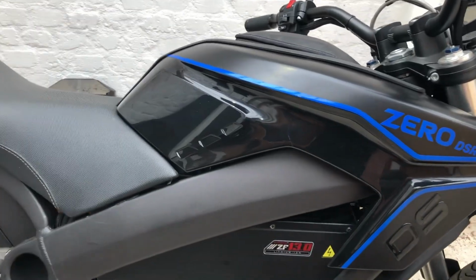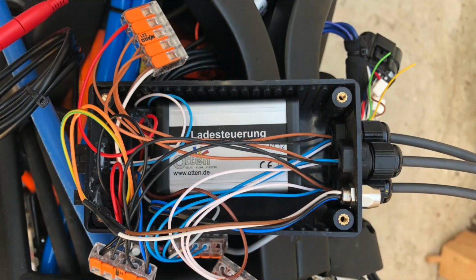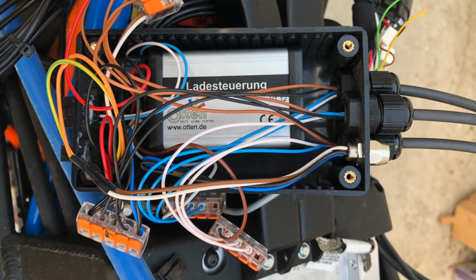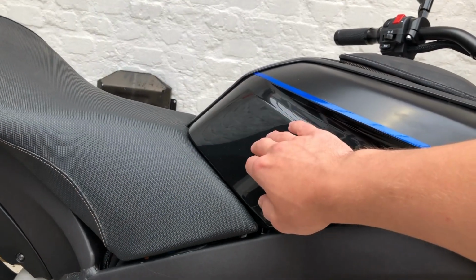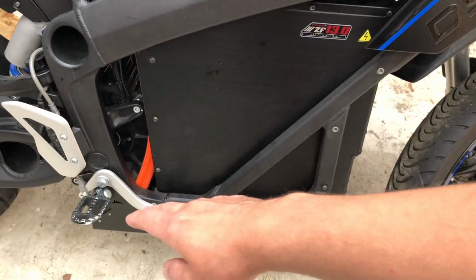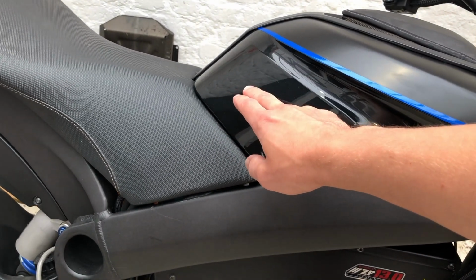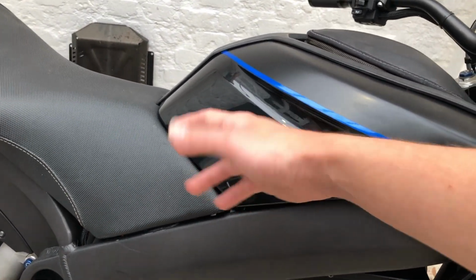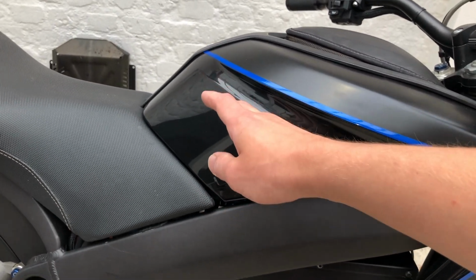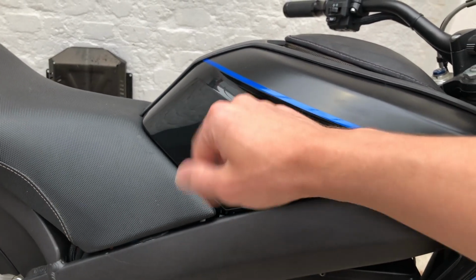front. Also below or behind the radiator itself sits our, let's call it a brain box. Inside the brain box we have a designated controller, nothing like an Arduino or such. It's a controller that is just there for the purpose of communicating with the chargers via CAN bus, and also to communicate with the charging station. So, well, I'm in Europe, so we have the Type 2 standard, but the communication standard should be the same like the J1772 plugs you have in the US.